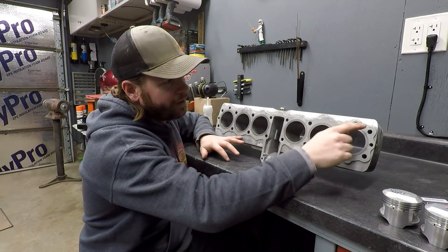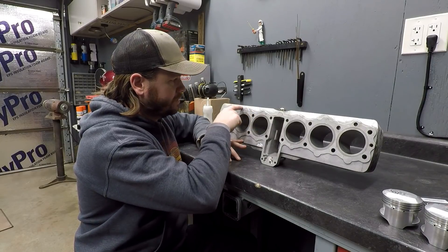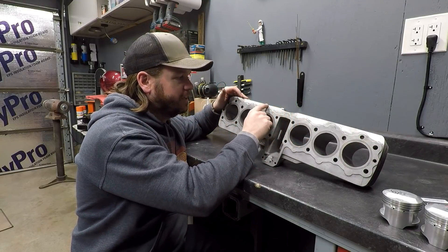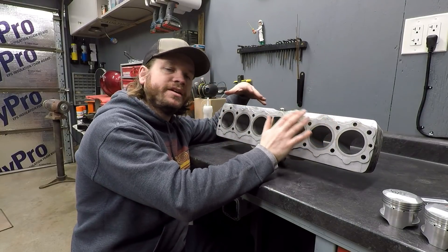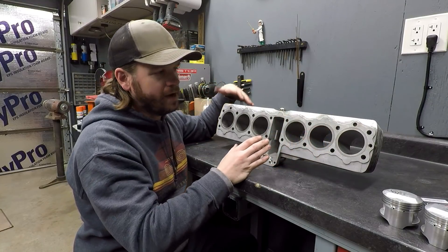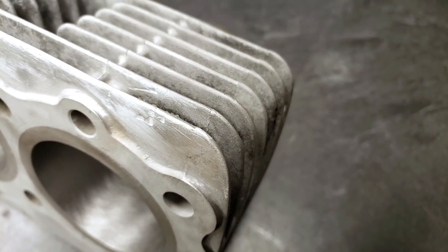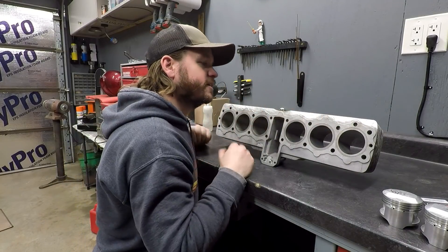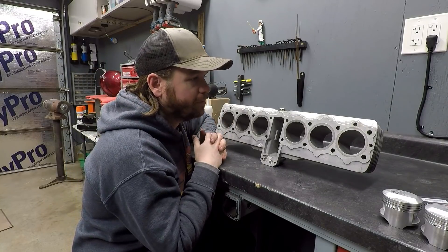This thing is looking good. I have the repair on this little section right there, and then three broken sections - there, there, and there. I just filled those with weld using pure filler rod - no plates or anything. I've spent some time sanding and shaping it to make it look like factory cast. I have to find that balance of not going too overboard, because I don't want it to look too perfect - it's a factory cast piece with natural imperfections. Really happy with it - a good quality repair. No JB Weld in this thing.